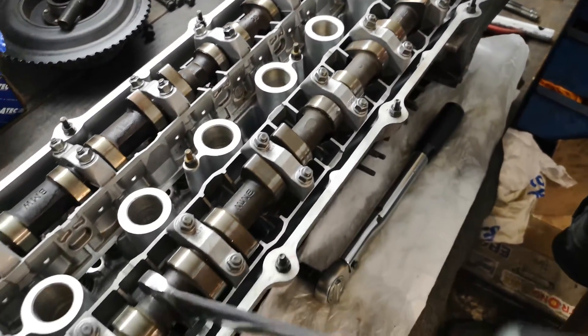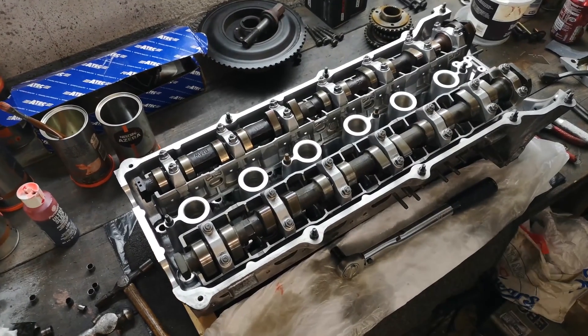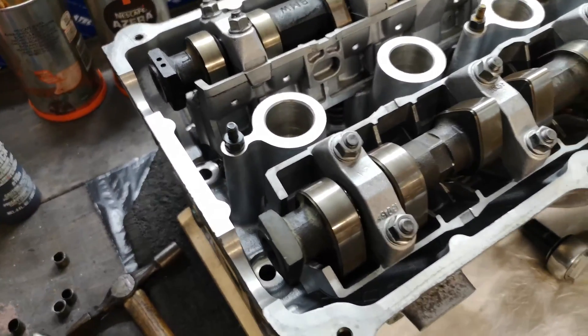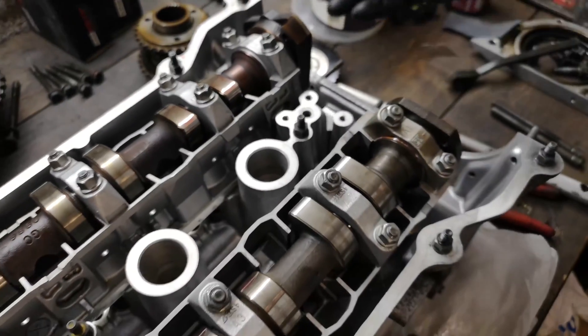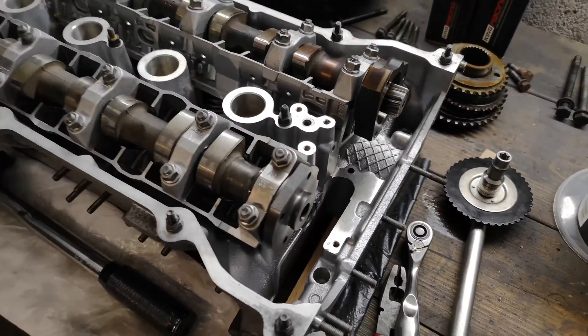So I'm going to clock this cam by 62 degrees - in other words I'm going to turn it so that it will sit basically the wrong way around for an intake cam but the right way around as an exhaust cam. The lobes then point towards one another and the sprocket should line up. We've had the sprocket machined and we've got the nose of the vanos machined on this side, as you've seen in previous videos. Now I'm ready to let this sit and bleed down the lifters.